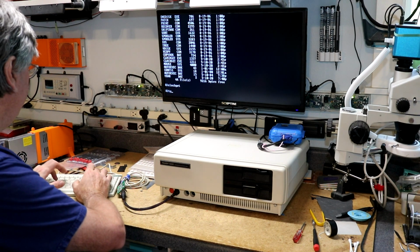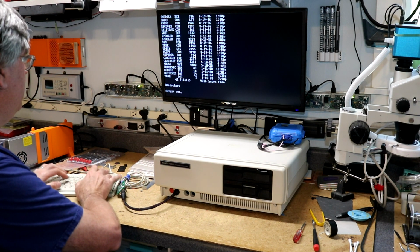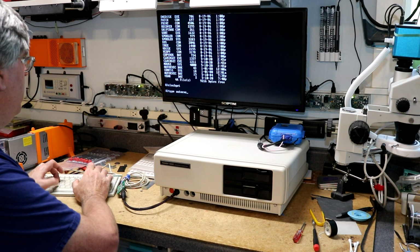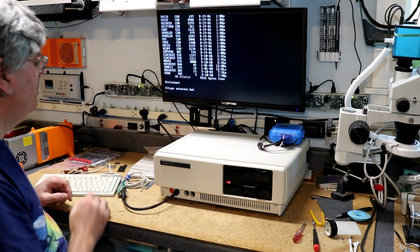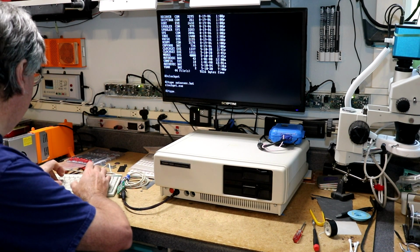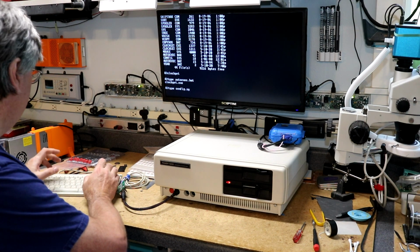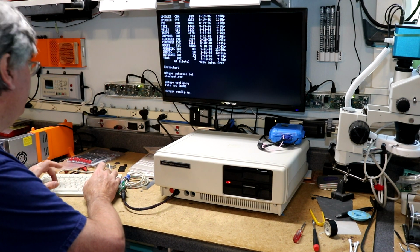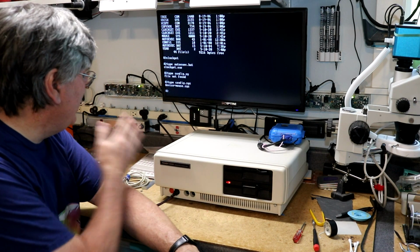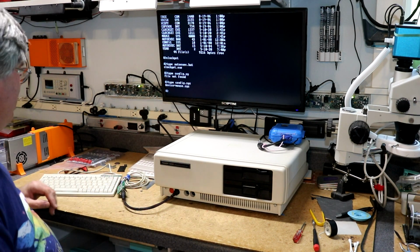we run it, it does not hang on exit, so that's great. So I have edited my autoexec.bat to automatically run the tool. Oops. I've edited my config.sys to automatically load the mouse driver.